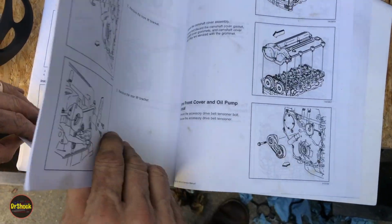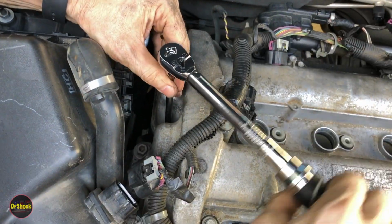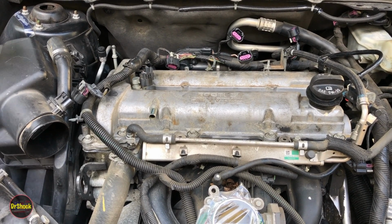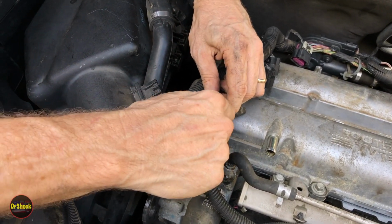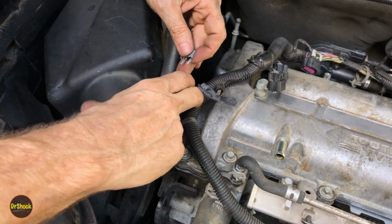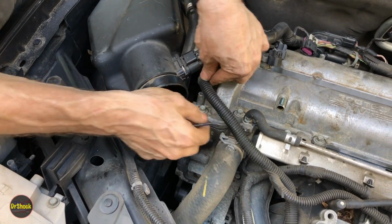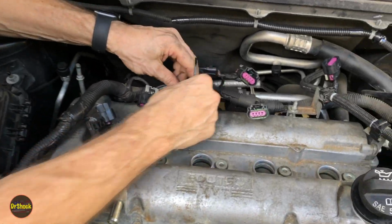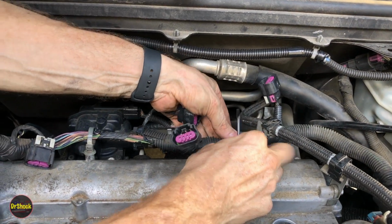All right, so let's go ahead and do our 89 inch-pounds. All right, guys, last one here, 89 inch-pounds. All right, at this point we can go around, start reconnecting things. So we'll move our safety clip out of here. And then we'll reinstall this where it was that holds the harness. And this one here. And this one here. All right.